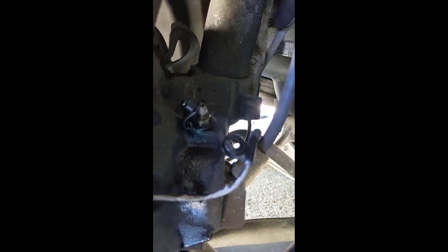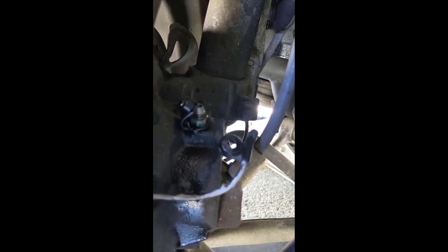You have to make sure there's no air in there. If you bleed your brakes and feel a spongy — not a solid — brake pedal, you still have air in it and you have to keep going. I have tons of BMW videos covering timing chain guides, suspension, and pretty much everything for these cars, so be sure to subscribe. We're going to work on bleeding this with a two-person system and see if we can get the air out, and then I'll show you how to bleed the clutch, which is much easier.